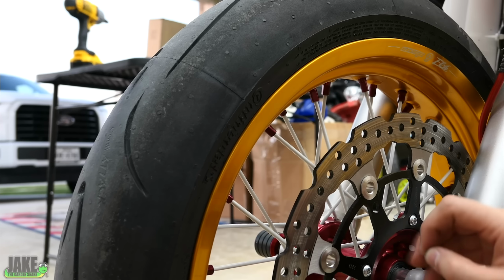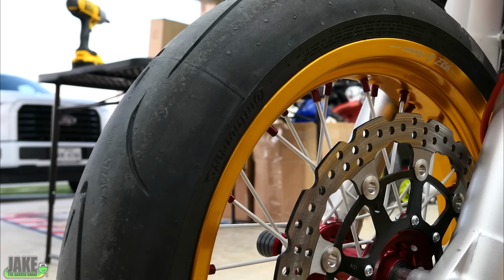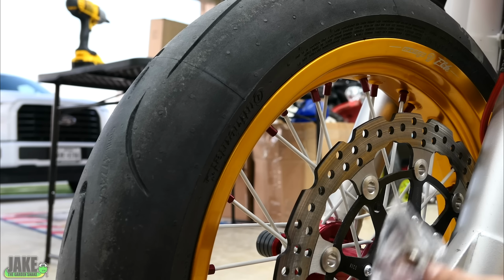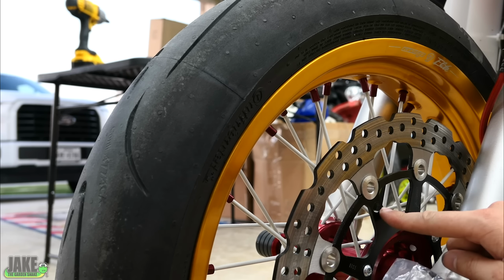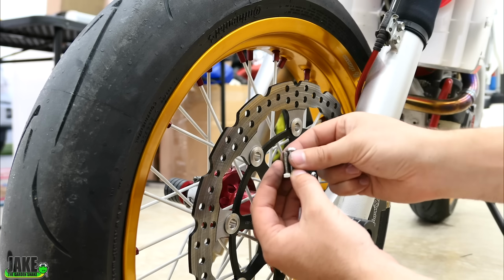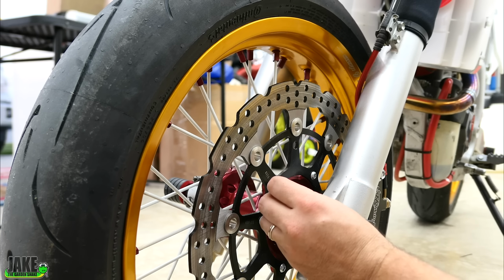There is from Warp 9 a retainer with a magnet you can get that goes in here and stays in here, but I do know we're going to replace this rotor with that flame rotor. I'm not sure when it's going to get here. So the other bit in here is a couple different size bolts. I'm going to see if I can use one of these bolts instead. That way, if we go to the flame rotor, which doesn't have this magnet hole in it, the sensor will be in the right spot regardless. Looking at the bolts that came out of here, it looks like this one's the closest match. It's slightly recessed on here, but it's very minimal, so I should still be able to get a tool on here.